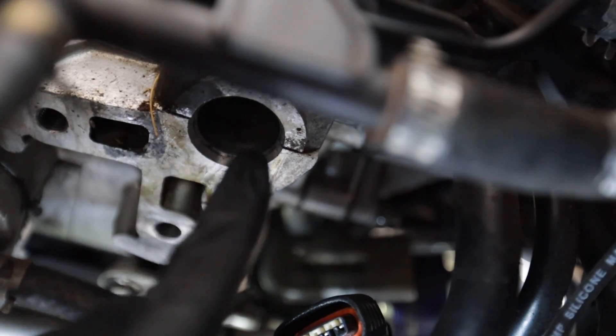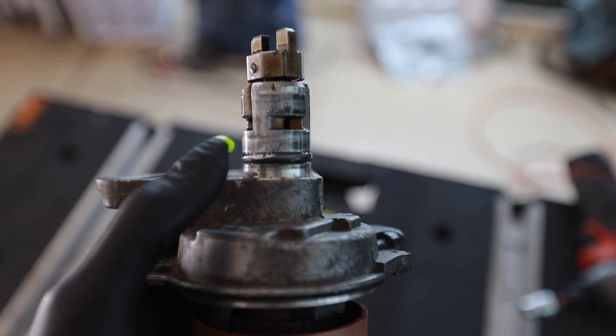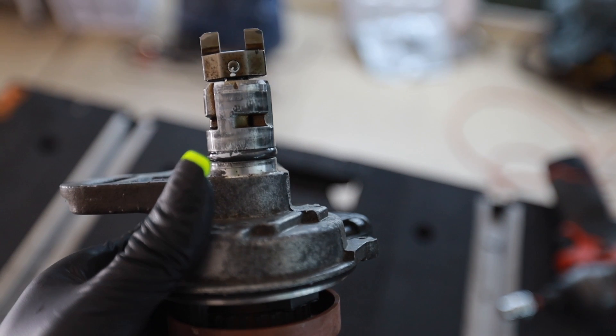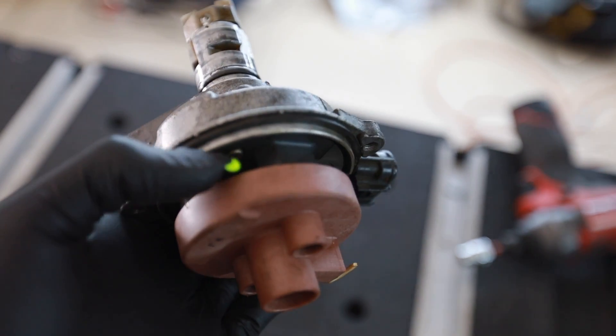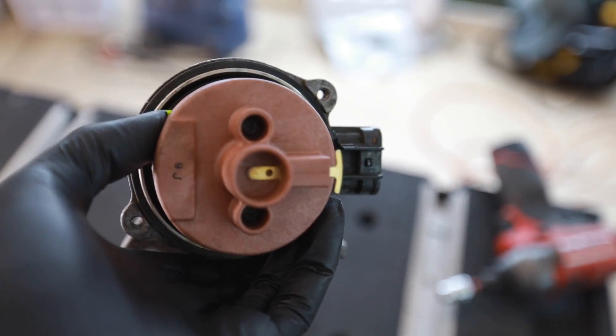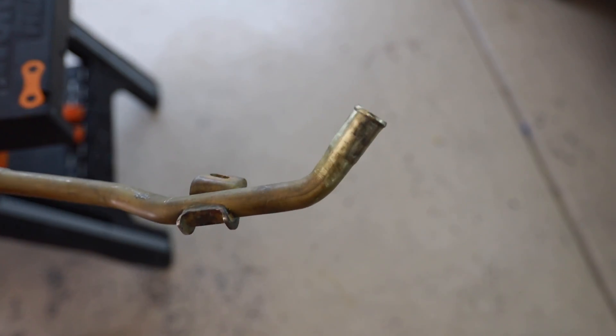A few months back I replaced the inner o-ring that goes inside here on the shaft. I put white paint marker on it — because I was smart and put paint marker on top of fresh oil and it got everywhere. Anyway, there's another seal inside here and oil is going through the center of the shaft and coming out on the sparky electrical side — that's not where I want oil. I gotta give a big shout out to Charlie. He just swung by and dropped off these lines that he repaired for me. He fixed where it was cracked and leaking, soldered it all back together, and completely redid the ends where they were bent and mushroomed out. It looks brand new again. I'm probably going to have him in the next video working on the MR2.